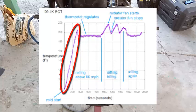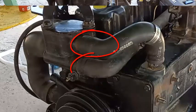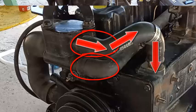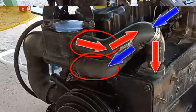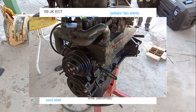It's a little different, but fundamentally the same: the thermostat opens and lets cool water in while hot water exits. In a boat, the same amount of water that's exiting the engine is the amount entering — that's why the two hoses on the thermostat housing are the same diameter. The same volume has to exit as enters — that's just common sense.